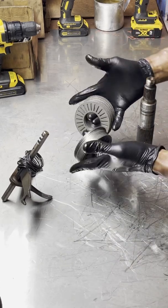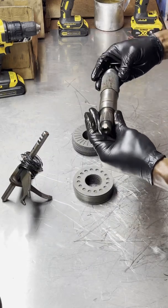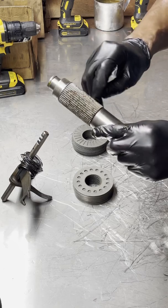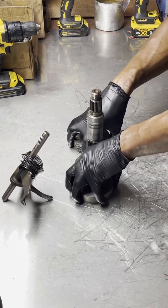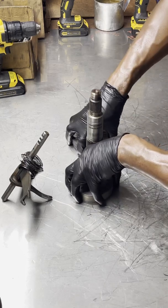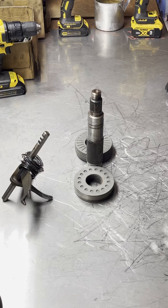Here it is — everything's split up. Every single one of these has to be cleaned, dried, and inspected. The shaft also has to be cleaned and inspected. You can see a little rust here — a lot of that has to get taken care of. Once it all gets taken care of, it'll be good to go to reassemble. I'll make another video showing some of the reassembly process. As you can see, it's a very time consuming process and I just wanted to share that to give people an insight into what has to get done to rebuild these viscous couplers. Thank you very much — if you like what you see, please subscribe to my channel.